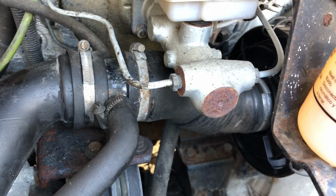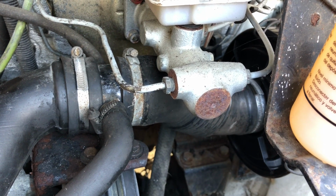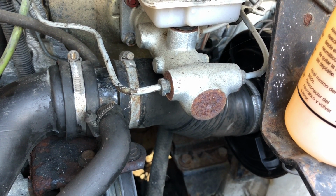So your car will be split front left, rear right, and front right and rear left. So if either system fails, you will still have 1 braked wheel on the front, 1 braked wheel on the back, 1 braked wheel on the left, and 1 braked wheel on the right. So that's quite clever. For some reason on this one, they've got this 3-circuit system. So you've got these 2 both do the front. So each front has its own system, circuit, if you like.